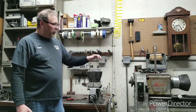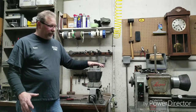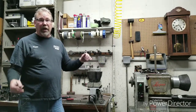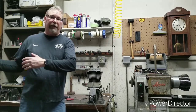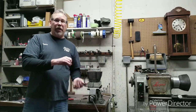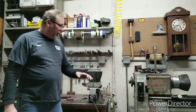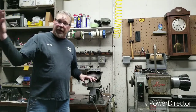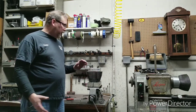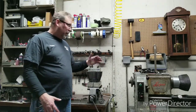Your heads actually make the horsepower — you get your head ported, there's a little more air, that's where all the horsepower is at. But you've got to do a good job on these cylinders. I've had guys where we ported heads for them and they said they didn't see a big difference. They had taken it to some shop or bought cylinders online and just bolted them on with a cam and heads, and they didn't see a big difference because they didn't do a leak-down test. We did a leak-down test and found 40% leak-down in the cylinders because they're way too big or they're not even round.